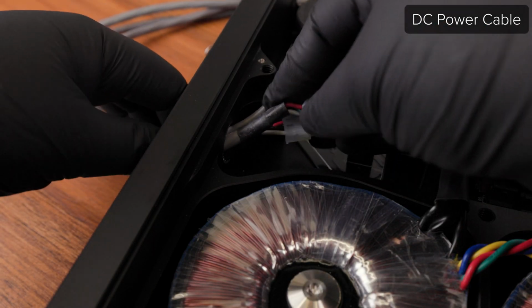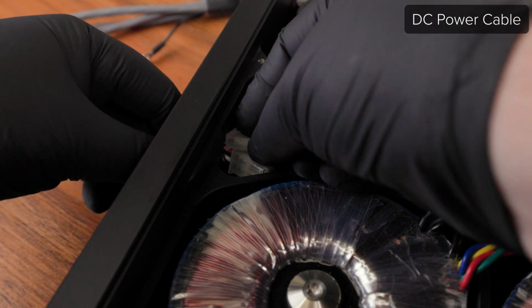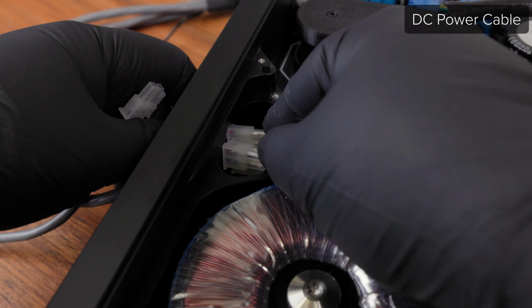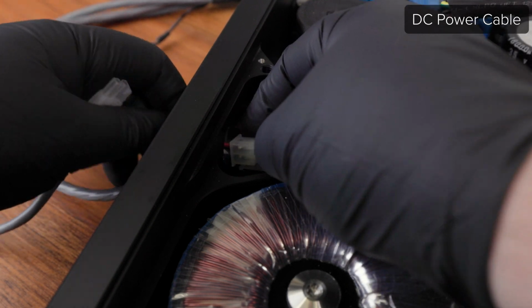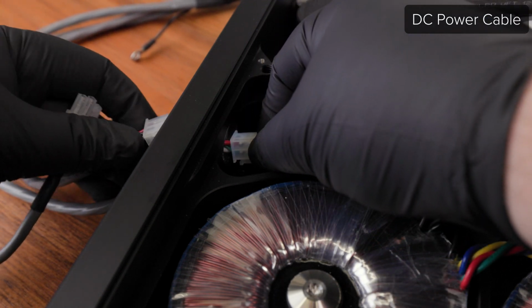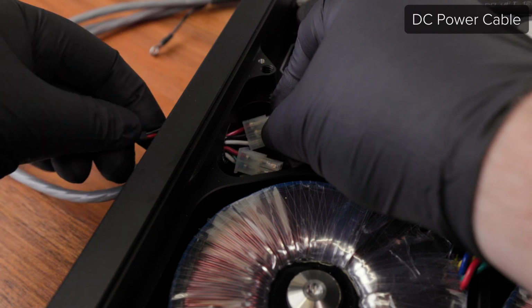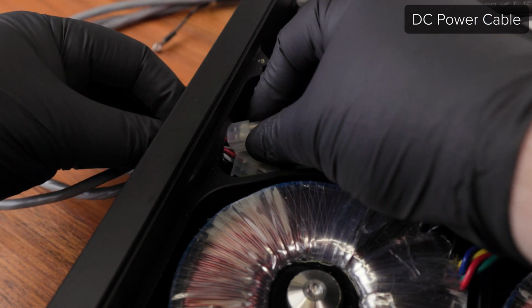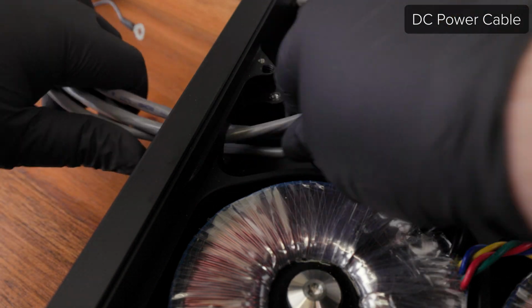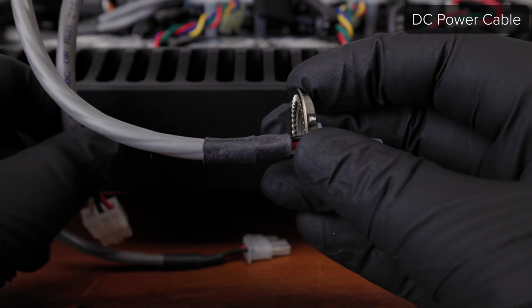After the nut and lock ring are off, use the same method to get the connectors through the hole in the jack panel. When reinstalling the cable, repeat the technique in reverse order by putting the 4-pin connector in first, followed by the 3-pin, and then the 2-pin. Repeat this again to get the locking ring and nut back onto the cable.